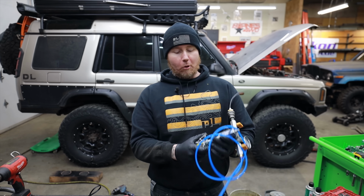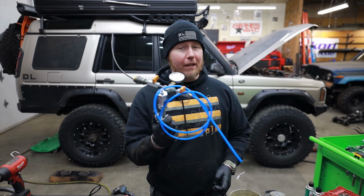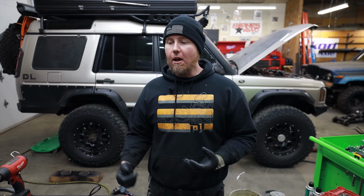So I am going to try and regulate the amount of air coming through. It needs less than a PSI to show bubbles. So we're going to put tiny amounts of pressure in it, and section by section, we're going to cross them off the list. Right now, we know there's definitely a massive leak in the top of the housing, but while I'm at it, why don't we check the axle shafts? Let's make sure there's no bubbles coming up around those O-rings.